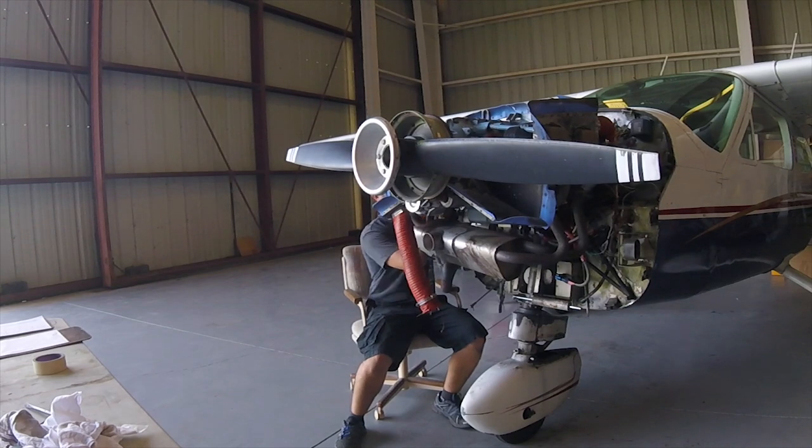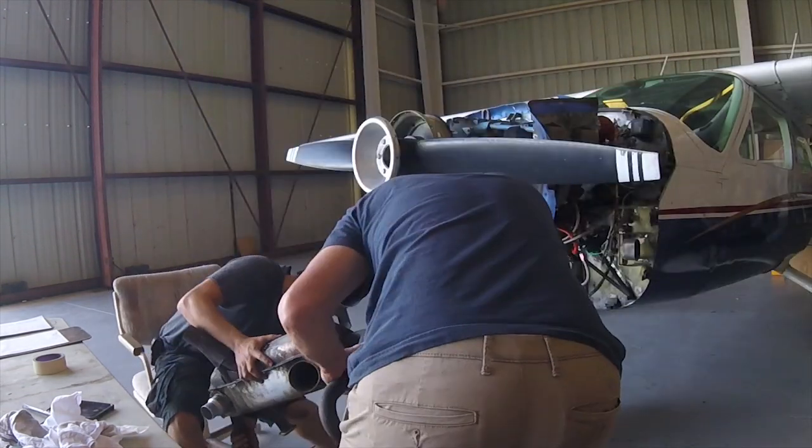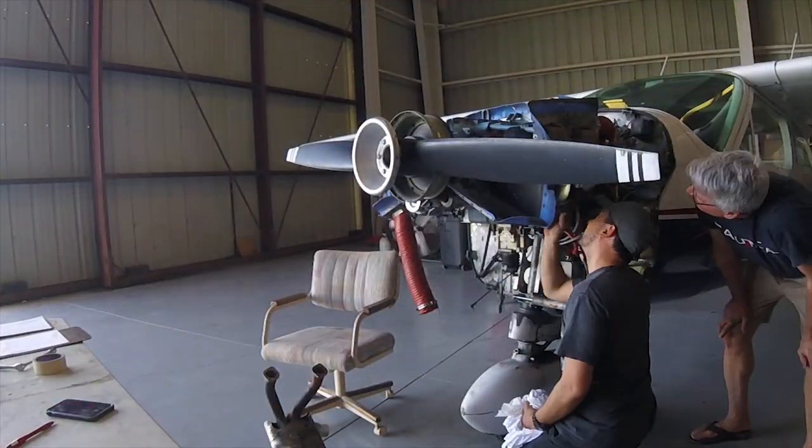And sure enough, we got in there, looked inside the exhaust, and yes, we did find a small leak. So the entire exhaust stack had to come out, and obviously the muffler had to come out too. I was reading up on the Power Flow exhaust and discovered that the internal core is really only good for about 300 to 400 hours. I've put more than that on my airplane since I've had it, and looking through the log books, I don't think it's ever been replaced. So we pulled the Power Flow off and took a look inside.